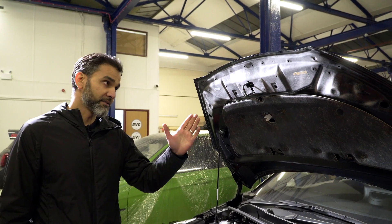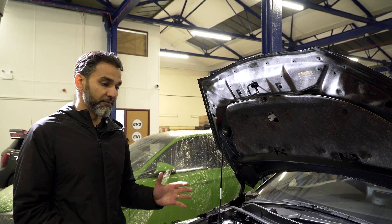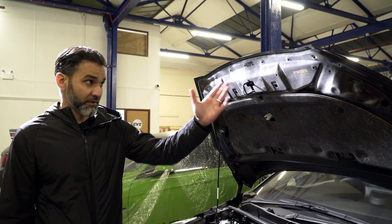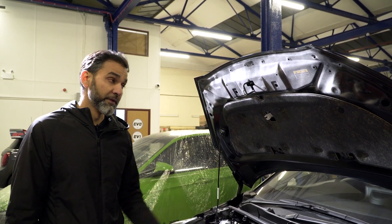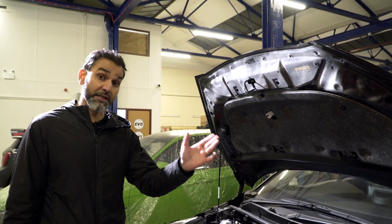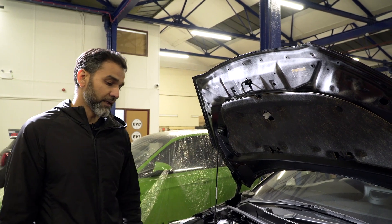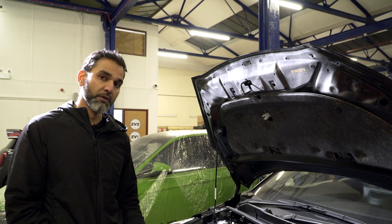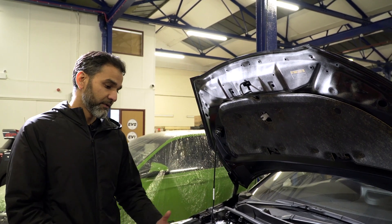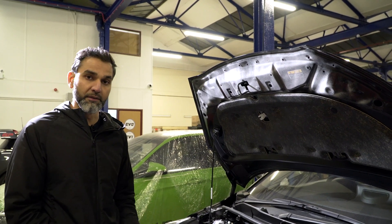The final part to scan is the underside of the bonnet, which will give me the maximum envelope available for the intake. You'll notice there's a white spray over the inside — this is a special spray which mats down shiny surfaces to allow the laser to scan better. With that done, we can look at the options available for the intake and offer in some existing designs to get a visual idea of the spacing available.